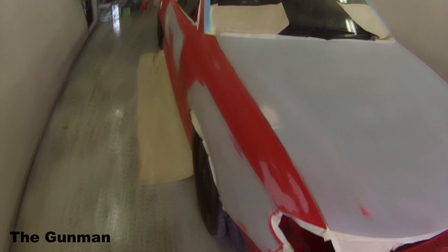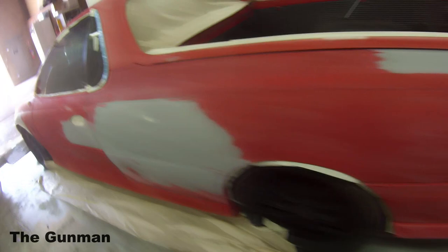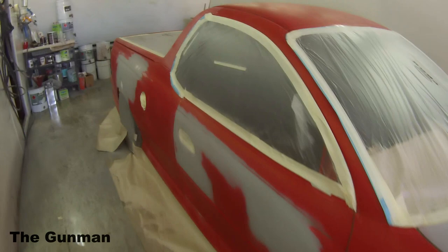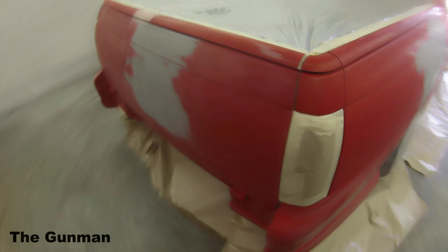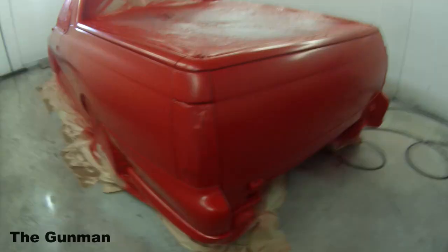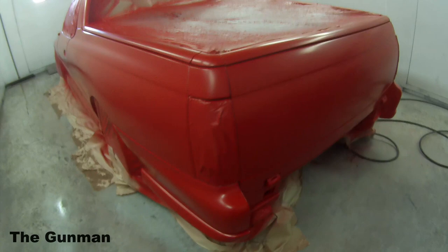After leaving it overnight, we took it out, gave it all a good block down on the primed areas, sanded the rest with the DA orbital sander, gave it a really good blow off, wiped it all down, and here it is in the booth. We've started doing the edge masking, then thrown a piece of plastic over the entire car, cut it out with a razor blade and taped it all down. In this spray booth, I've found it works better if we put a bit of water on the floor to help keep the dust down, since it's not a full downdraft booth and we can get little vortices that pick up dust from the ground and land on the job.